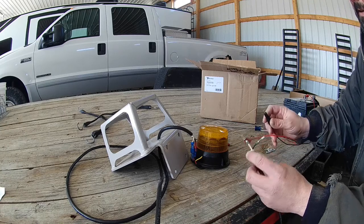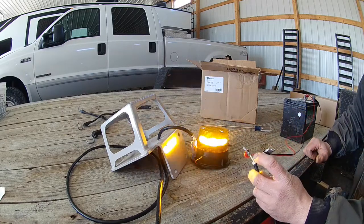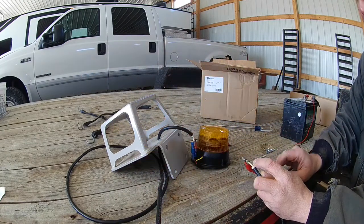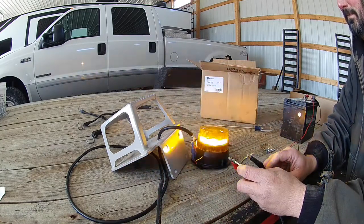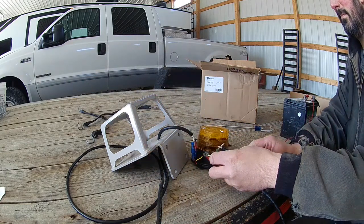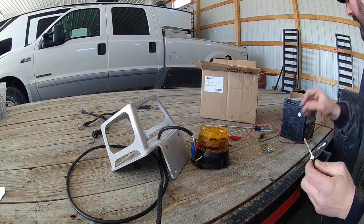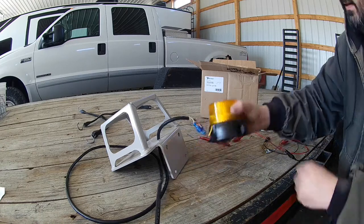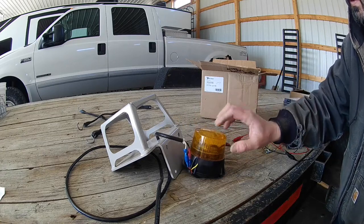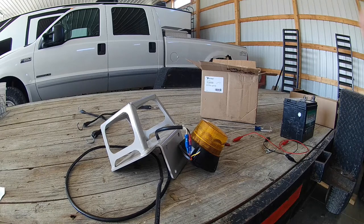Once you get your leads hooked up to a battery, the positive wire on the cable that comes with your strobe light kit is white and the black one is negative. That's the standard pattern when you buy this kit — this is what the light comes in. If you shave that wire back and just tap it to the positive, you can go through your different modes on this light and change them. Once you get the mode selected, just lightly cut the wire back so if you ever want to change the mode again, you can peel off a little wire and do it again. Most of these LED lights come with a mode selector wire like that.